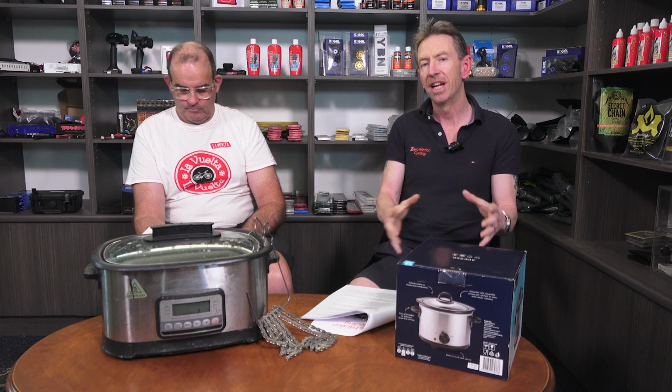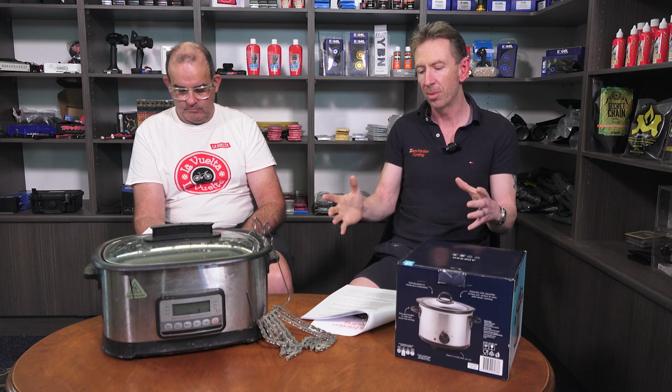But when you do a relube, you are adding, most times, say 5 mil onto a chain that's over 100 links long. So you're adding, say, less than 0.05 of a mil per link every time you relube. So the ratio of contamination to lubricant when you're doing that gets pretty bad pretty quick. Much, much faster than if you were to pop the chain off and put it in a pot of 500 mil of 100% lubricant. So the rewaxing is just going to reset it time and time again back to near zero and get things super low friction, super low wear.